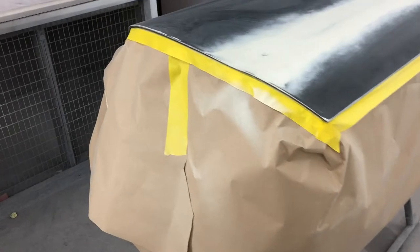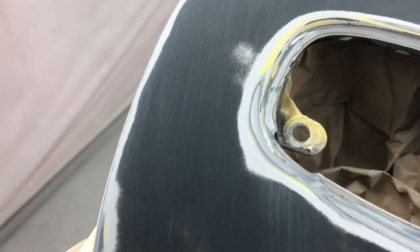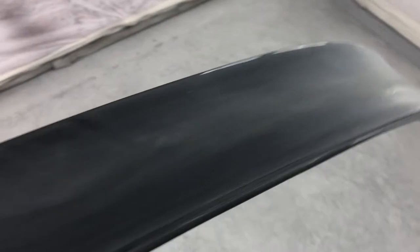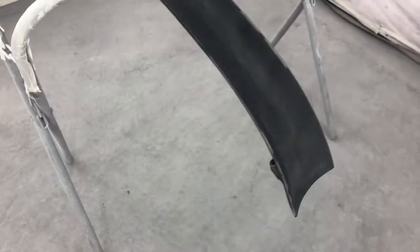The epoxy does two things. Number one, it's gonna seal all the repairs and stop any shrink back. But number two is, you use epoxy on any places where there's bare metal. Okay, you used to use acid etch primers, but we use epoxies now. So that kills two birds with one stone. Seal it in and treat all the bare metal bits. And we'll let that flash off, give that 15 to 20 minutes, and we'll get over it with some black primer, okay?